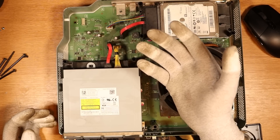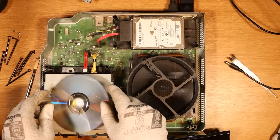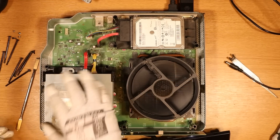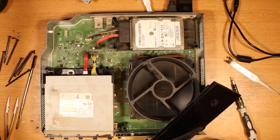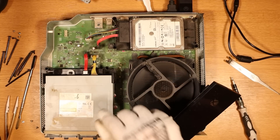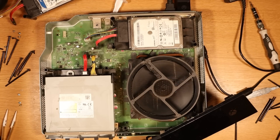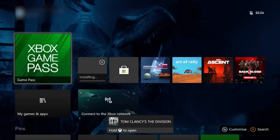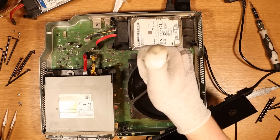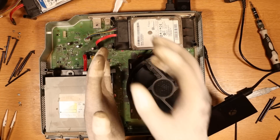I'll do the exact same as last time — take the board from this one, swap it out and put it into a new disc drive. I can't hear any noise. I'm just about to put a disc in and see if it works. This one was from quite a dusty Xbox, so my hopes aren't that high. It does not sound healthy — nothing has come up on the screen. Let me try another disc drive. Second time lucky — new disc drive, let's go. Tom Clancy's The Division. Sounds good, spinning up nicely. Does it show on the screen? It's showing. It recognises it and it's installing. Xbox number five is fixed. I technically have four out of five Xboxes working.